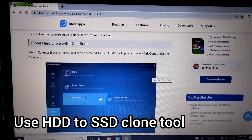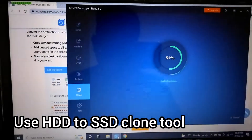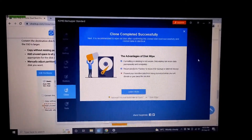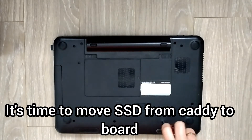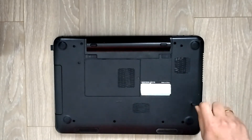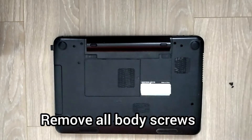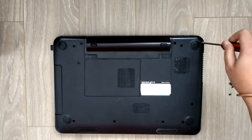The main idea is I wanted to use the old HDD as a secondary drive, that's why I invested in a caddy. Otherwise we could just buy a USB to SATA cable and get it done. But what I've done is install software and clone the device - HDD to SSD. Once that is done, I need to make the SSD the primary disk: attach it to the motherboard, remove it from the caddy, and put the old HDD back into the caddy to use as secondary storage.